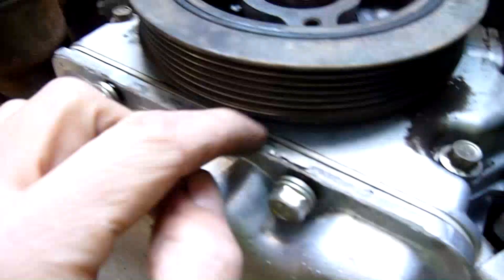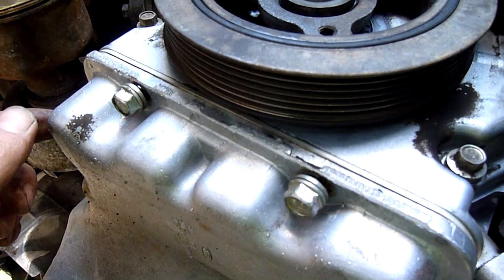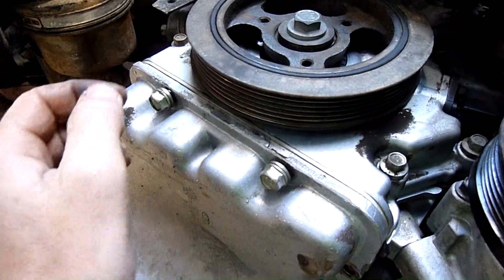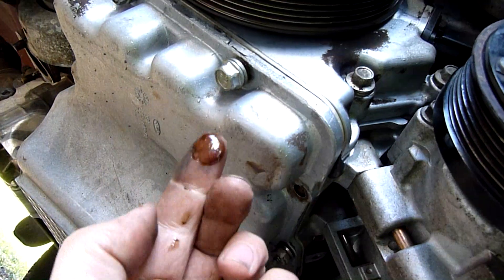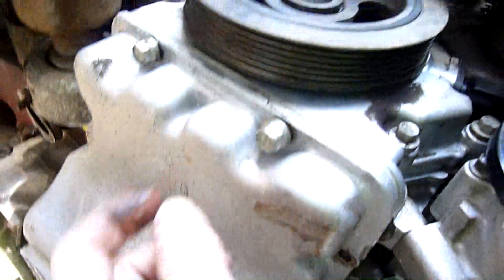It's stuck there, but that's the gasket — it's an aluminium sheet, punched metal sheet with rubber on both sides. Just a thin bead of it and it's obviously gone bad or gotten squeezed out. And it's started leaking. Same with around the bolt holes — most of them are flooded with oil.